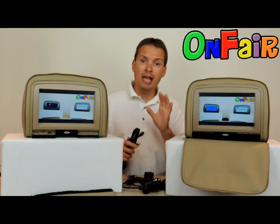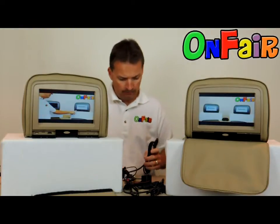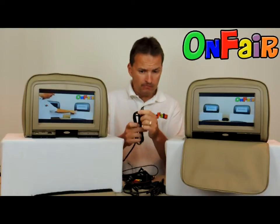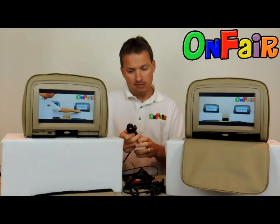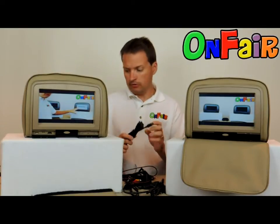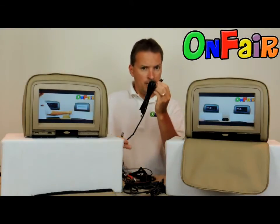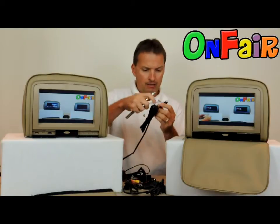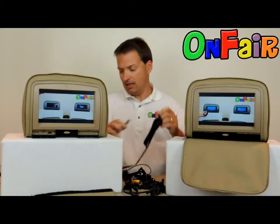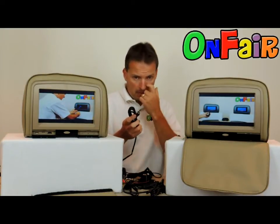This is power cable A — it's an older model, been around a lot longer. The key is it's got a bigger end on it. It looks like an S-video end. If you're looking at your headrests DVD player and it's got a big end on it like this, it can't slide through the post — the post gets stuck at the end because it's too big. It's most likely this cable.